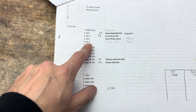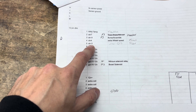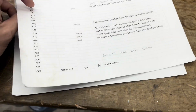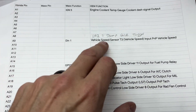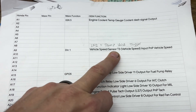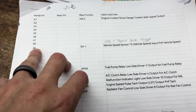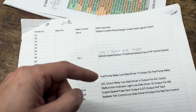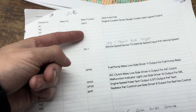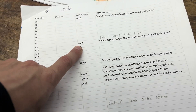I figured out that I have an extra digital input. Why do I have an extra digital input? Because as you guys can see here, digital input one was wired up to the factory speed sensor on the factory S2000 on A9 on the factory harness. I was looking at it and realized I don't even use VSS anymore because we use two digital inputs — front and rear wheel speed — so now that leaves us a free digital input.